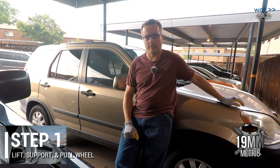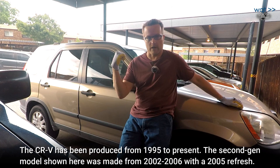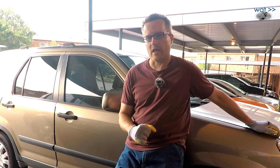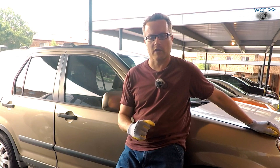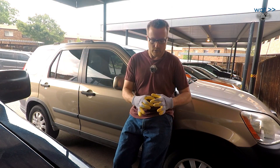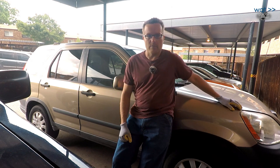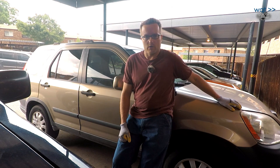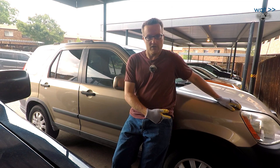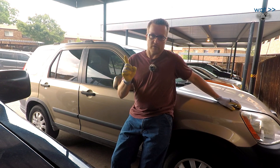Today we'll be working on this 2005 Honda CR-V. It was made from 2002 to 2006, and it was updated in 2005 with a slightly different front and rear fascias. Now, those of you who have ever owned one of these know that for Honda CR-Vs of a certain age, there are a couple problems that can crop up. One of them is the front lower control arms. That front lower control arm in one place uses a large round rubber bushing where there really ought to be a ball joint. In my experience on this vehicle, at about every 40 to 50,000 miles — it doesn't matter how good a quality one I put in there — it goes out again. So today I've got to replace both of those. Should be fairly straightforward; it's basically four bolts on the control arm, but of course, old hardware, rusty nuts — we'll see what it actually takes.